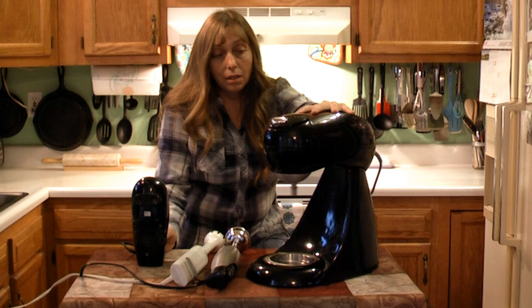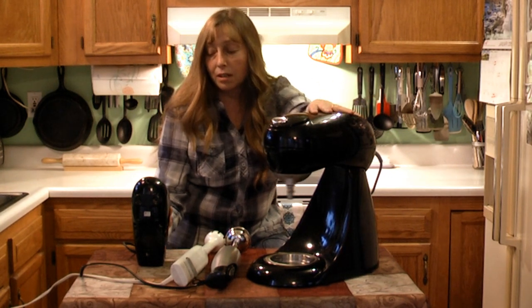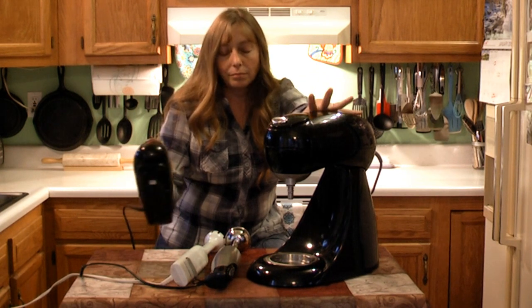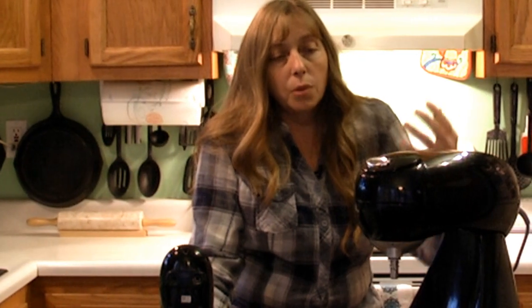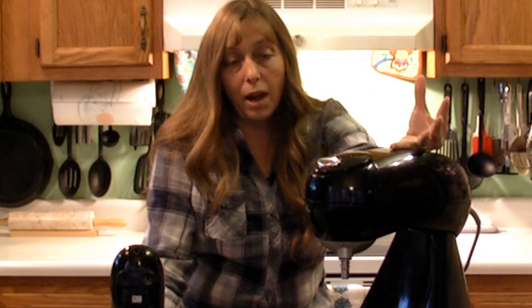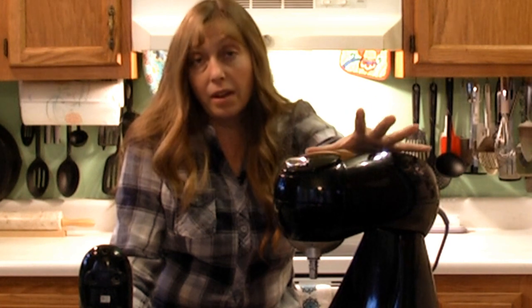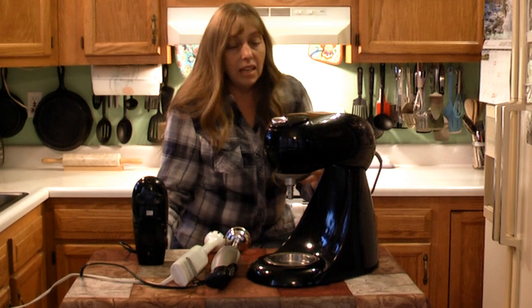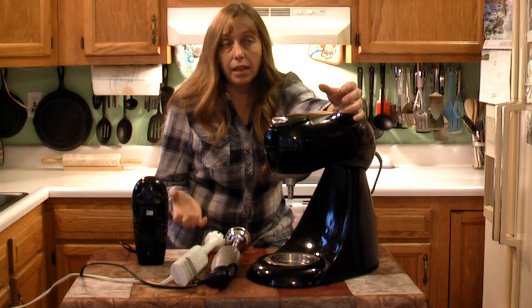I can show you how I know that by the way they sound. The more expensive mixer is noticeably quieter than the cheaper mixer, which is much louder. So this more expensive mixer, with smoother gears, more lubrication, and bigger wire, I'm going to be able to run it a lot longer without it overheating.